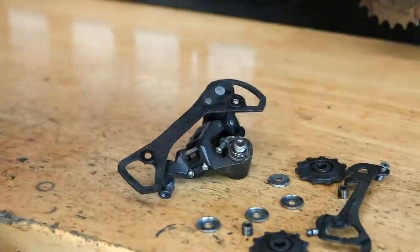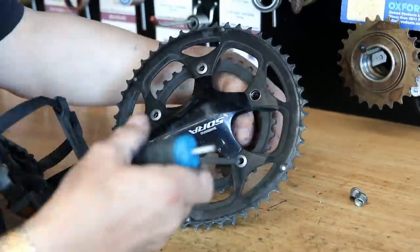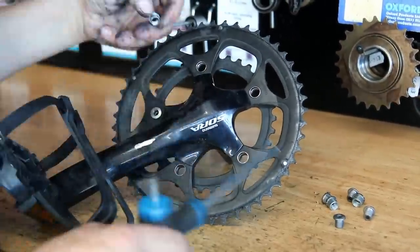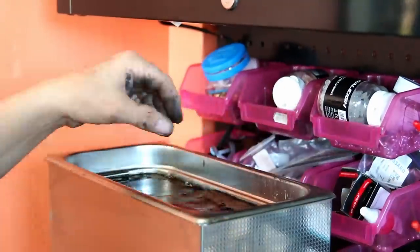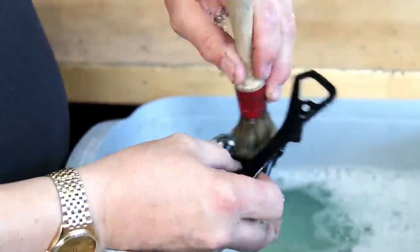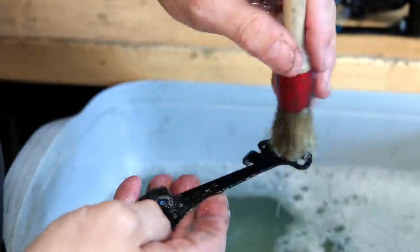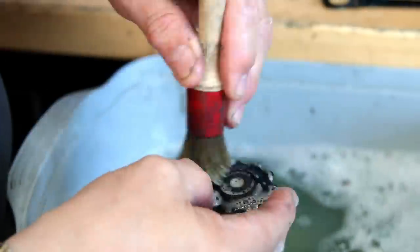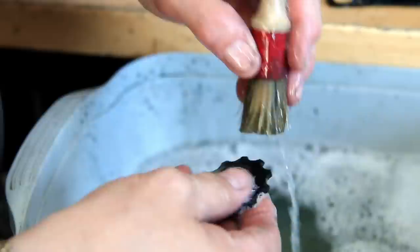That's when you need to clean your chain or refresh your oiling system — you end up with this residue build-up, which is what we aim to clean off when we do a Bike Speeds service. We'll either clean or replace the chain, clean the chain rings, clean the derailleurs. This is a routine service — not a full stripped-down service — just cleaning components and re-lubricating them.